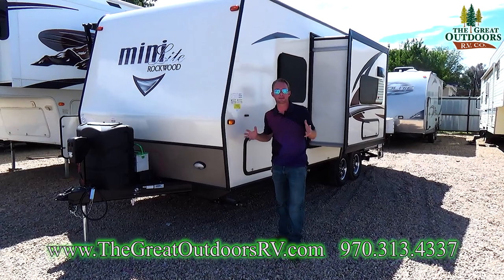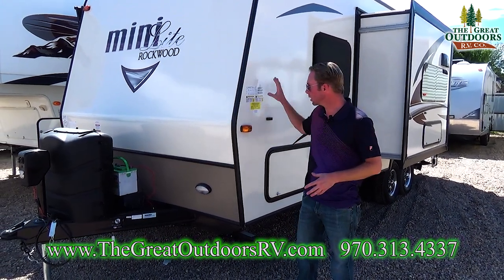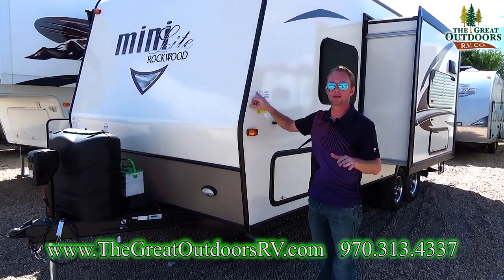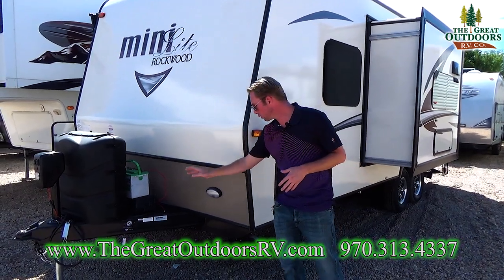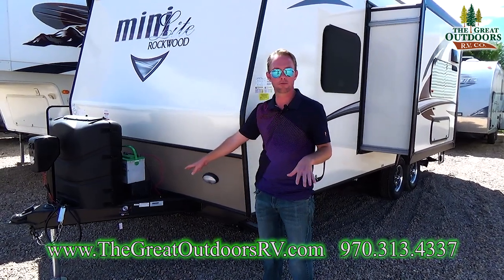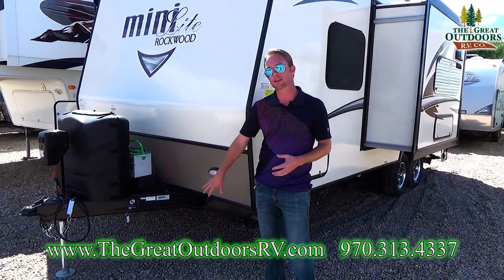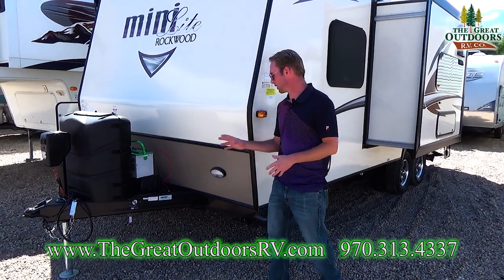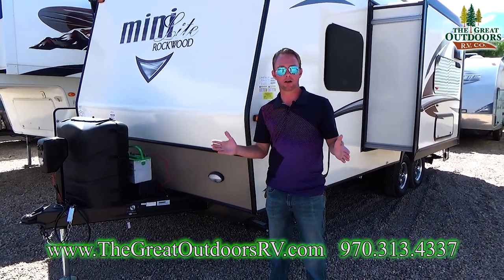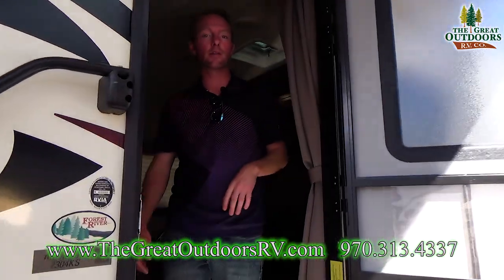One of the most important things to consider when looking at a coach is what your tow vehicle is capable of towing. Most coaches have the gross vehicle weight listed on the front driver's side — this one comes in at 5,876 pounds gross weight. The dry weight, which is what it weighs without any water or cargo on board, is just under 4,400 pounds, so it's still a pretty light coach. Pretty much any half-ton on the market today can tow this coach. The difference between your dry weight and max weight is your cargo carrying capacity — what you can put on board.